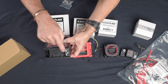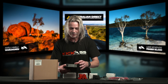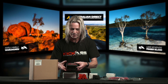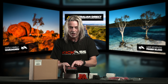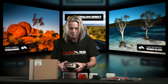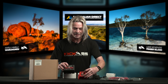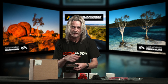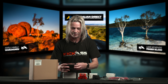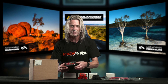The beauty of this one is it does have Anderson plugs, so anyone familiar with those will find it nice and easy to connect in — there's no complex wiring, just running the Anderson plug. It also has the override switch exactly as mentioned before, so if you need to get out of trouble you've got that little override switch. Just remember whenever you are using an override it's not instantaneous — you normally need to let it sit for about four or five minutes to let the batteries equalize, and then you should get a nice start if you need to.